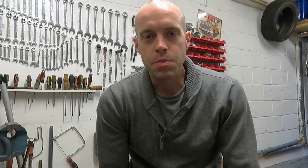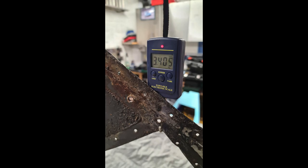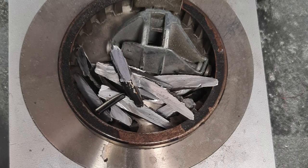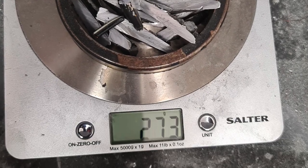Now that I've finally seen how much it weighs, I think I can do better. I've taken some weight off the under tray under the engine — originally it was a 3mm steel plate and I've replaced it with a 1.5mm aluminium plate, which saved me 2.2 kilograms, taking me to 618.3 kilograms. I've also chopped off some excess bits from my steering column, bringing it to exactly 618 kilograms.